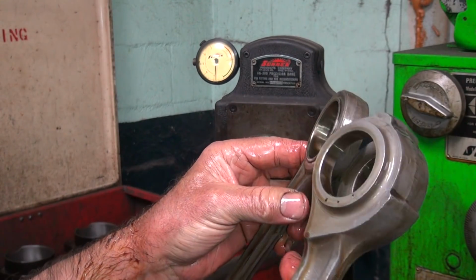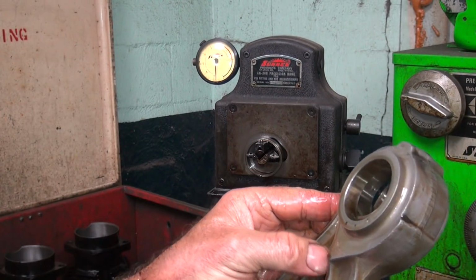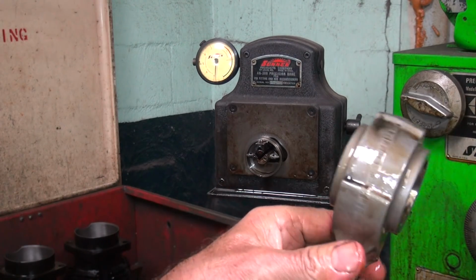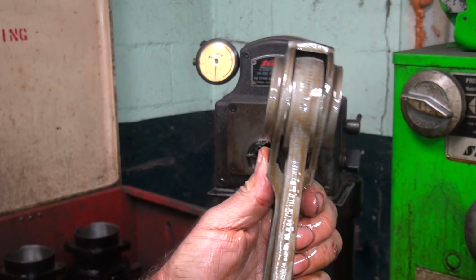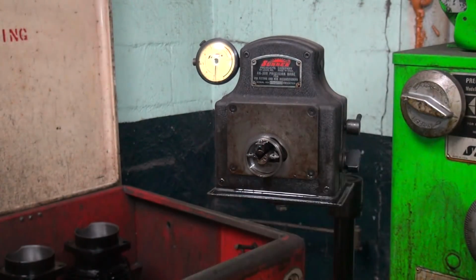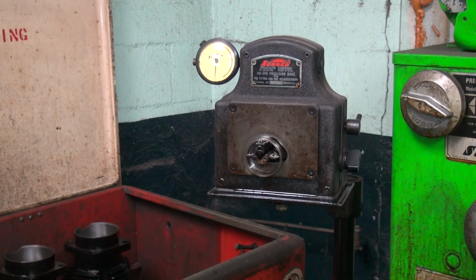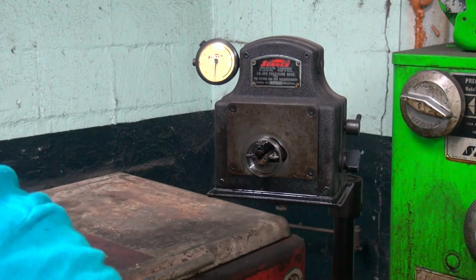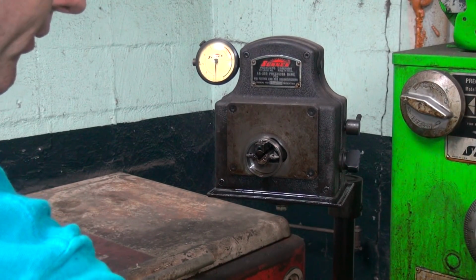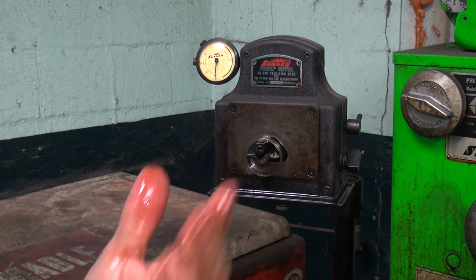It only took out a couple tenths from the biggest side that I had. I only went out maybe 2 tenths at most. So about 2 tenths. So that's not too bad. You take almost a thou out around with only 2 tenths of loss. That means you're doing a pretty good job. So the factory's not that close. Alright, so that's where you're at. I'm going to go clean these up right now in my hands. I'll be back.